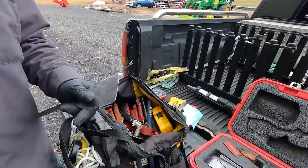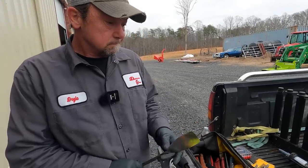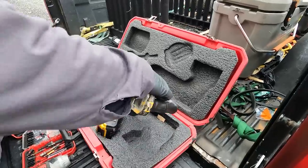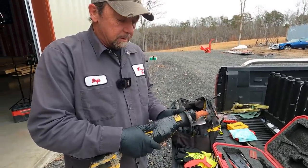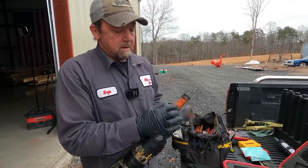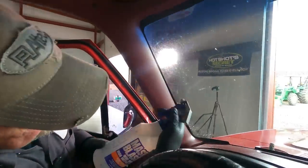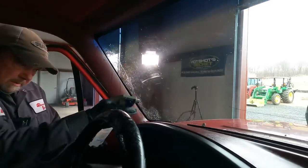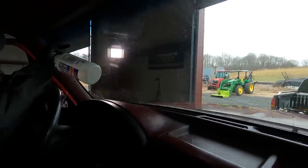So, what you got there? This is the blade that goes in the equalizer tool that we'll use to cut it out. It's the equalizer tool — not very pretty. I had a guy ask me the other day, 'Man, you need a new saw.' And I was like, 'This is pretty new.' He asked why it was taped up and bandaged, and I said, well, when I have to save a windshield, this piece here is metal, and I cover it in tape so it won't scratch up the glass I'm trying to save. Before we cut it out, we're going to spray it with basically mostly water with just a drop of regular dish soap — it will not cut dry.